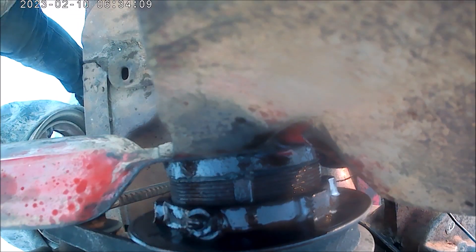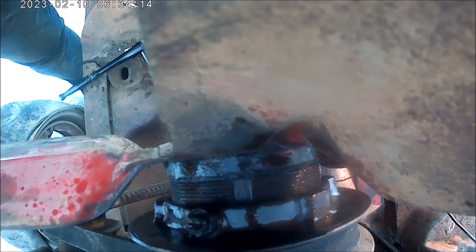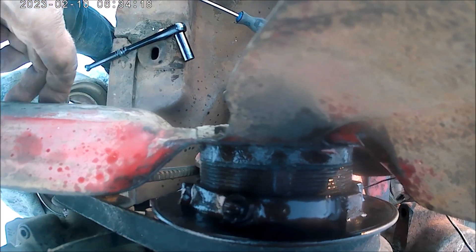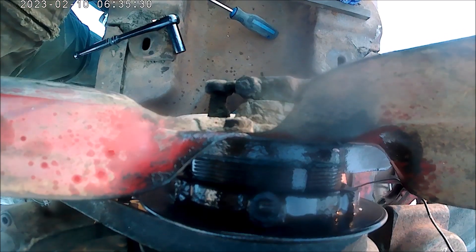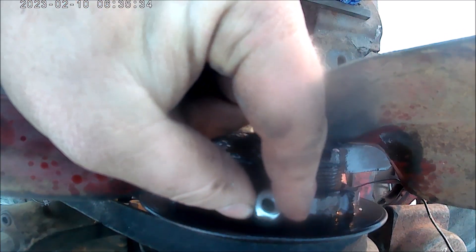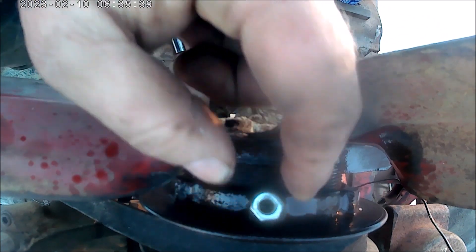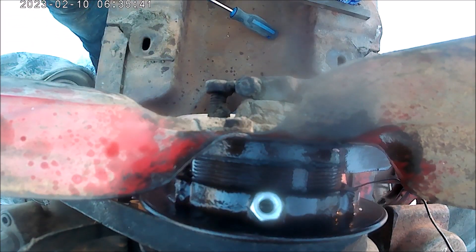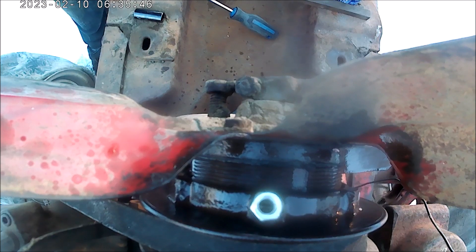What I can do is back this off — it's half inch — then double-nut it and make it go. I'll take an ordinary five-sixteenths nut and screw it on top of the jam nut if I possibly can, tighten it up, and then try and back the whole thing off from the bottom nut. That should ought to do it.